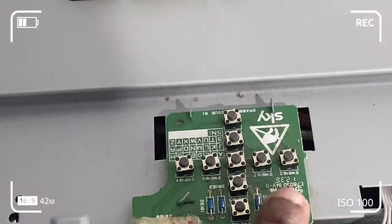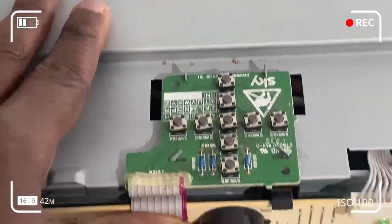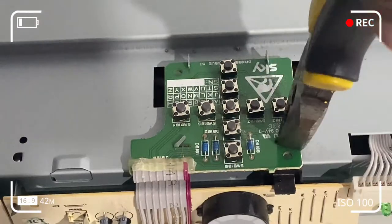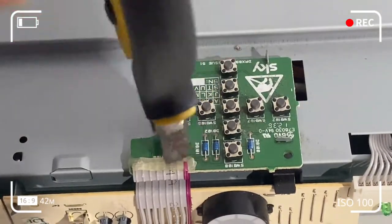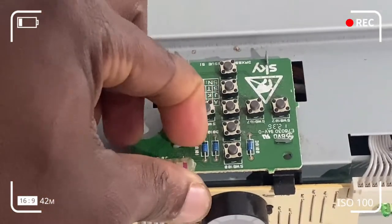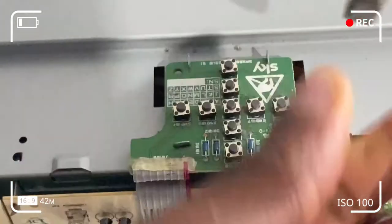The next stage is to take off the top casing. In order to do that, we need to get the bottom PCB off. If you haven't got those pliers, you can use your regular pliers. All you need to do is align the metal brackets used to secure the PCB onto the metal case and align them back into the original holes. Just turn them, make sure they're aligned with the elongated holes, and you'll be able to get the PCB off relatively easily.